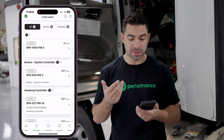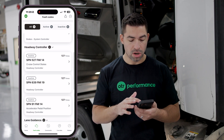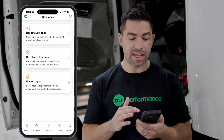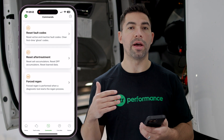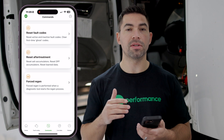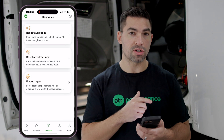If you have fault codes specifically on the brake system, the headway controller, or lane guidance — this truck has a few inactive fault codes. Next, we'll navigate into the Commands section. This is where you get the power to actually perform a function, also called bi-directional commands, where you can send a command to do something to the truck.